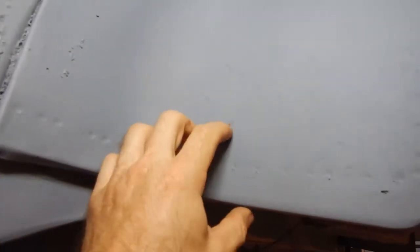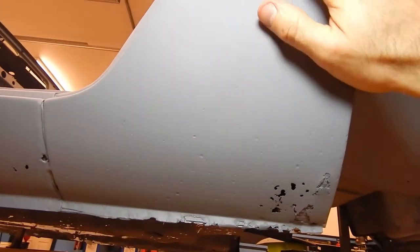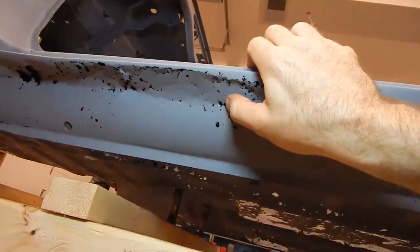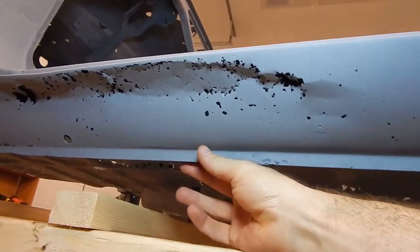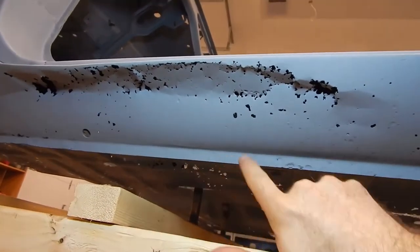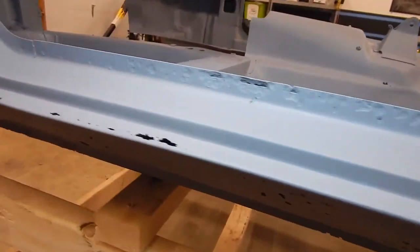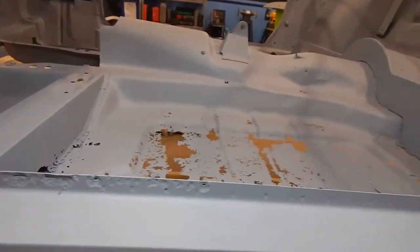Going forward, we've got our rocker — this is the front of the rear quarter panel, and again, a typical rust spot. Same with the rocker: this we were not surprised about, we saw this all in the car. It's kind of caved in and rusted out, so it's going to need these rockers replaced. But here's the lower end — it's really not that bad. There are all the spot welds. Yes, it certainly isn't great, but the fact that this still exists is pretty compelling. All in all, I really thought this was going to be worse off, so I'm pleasantly surprised. A lot of people look at this and say it's all rusted out — but I've seen a lot worse on these cars.